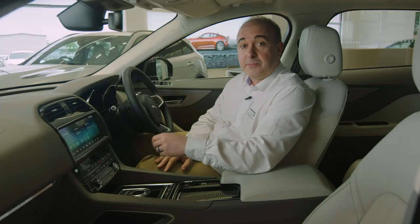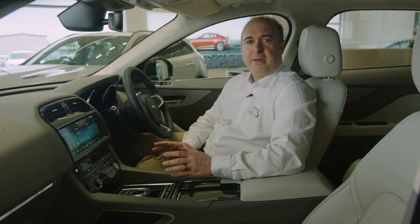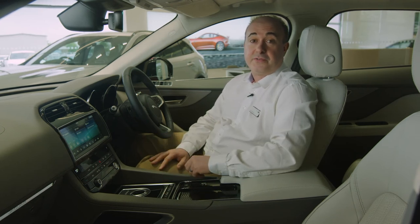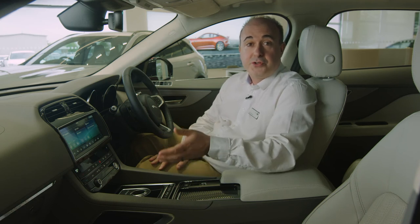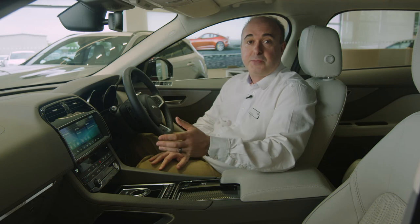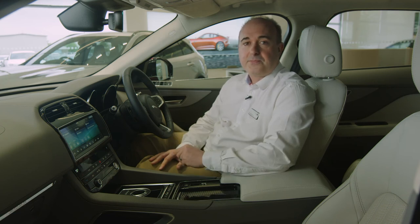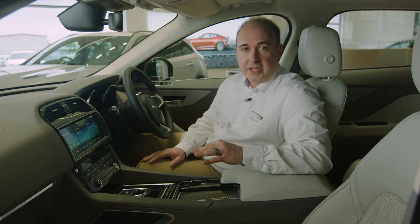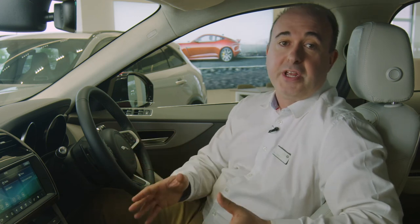When you come to a stop, you can rotate the dial back to park, or switching off the ignition will automatically return it to park before it descends back into the console. The F-Pace has a range of driving modes accessed with buttons just rearward of the gear shift. Set to comfort as standard, the arrow buttons will cycle through dynamic, eco and rain/ice/snow settings, useful for low traction surfaces. Each mode will affect the power delivery, gear shifting and traction control to give the best possible control and response. More information about these modes and the all surface progress control can be found on the iGUIDE app. The electronic parking brake will disengage automatically when you drive away and re-engage when you switch the engine off; a manual override control is located on the centre console. When driving, be aware that a start-stop system is standard, so the engine will cut out when you come to a stop, instantly restarting in the time it takes for your foot to move from the brake to the accelerator when you pull away.